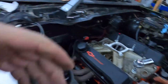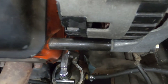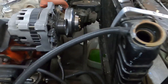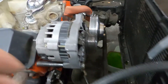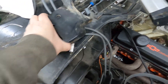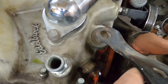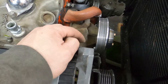Basically you're looking for straightness, and this is nice and straight between the two pulleys, so there are no alignment issues. That spacer fits exactly the same as the old alternator. The one thing I don't necessarily like is that the stud for where the power goes is back there, a bit awkward. I'll get a boot over that and it'll be fine. The alternator doesn't move. I don't have the upper bracket on yet - I have an old bracket, but the intake manifold doesn't have a proper support place for it, so I'll probably use a heim joint configuration to tighten up the spacing.